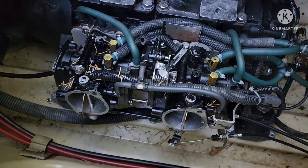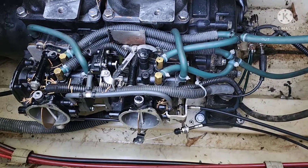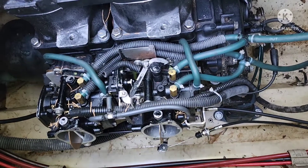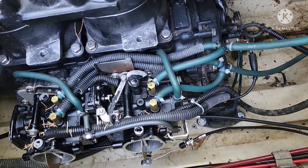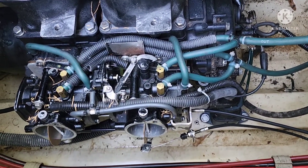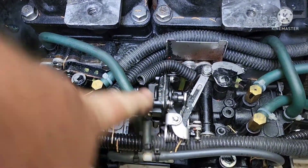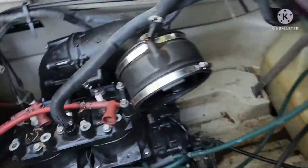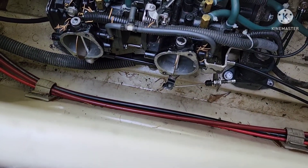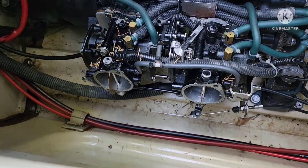On this fuel return line — that's what I'm doing. If your carburetor is running right there's no need to pull it, but I'm going to rejet this one with slightly bigger jets than factory, because they say it makes cold starting easier on these. Remember, these have a little squirty primer system which you can easily test by taking a white paper towel or napkin. Here's your accelerator pump — if your pump isn't working when you squeeze the throttle, have your napkin sitting in here. If you don't get fuel wetting on the napkin, you may have a clogged jet on the accelerator pump.